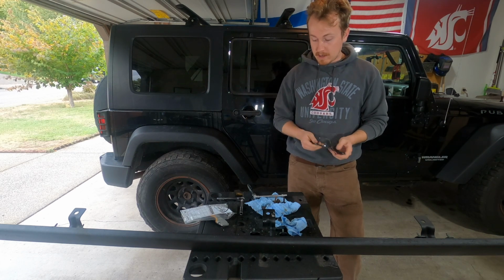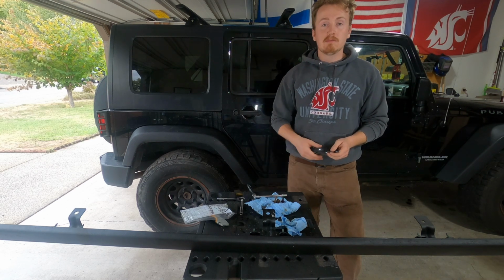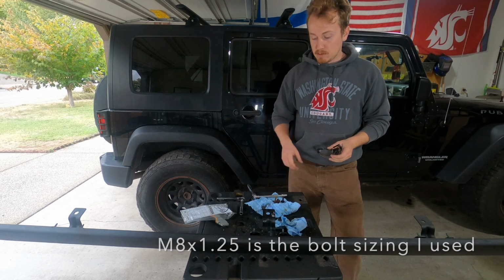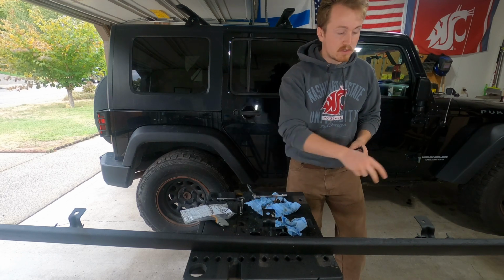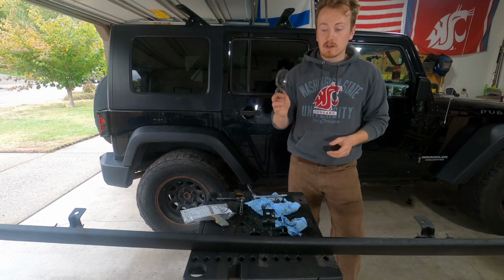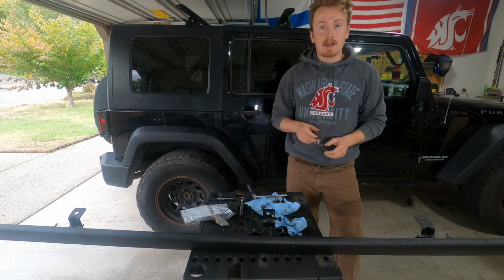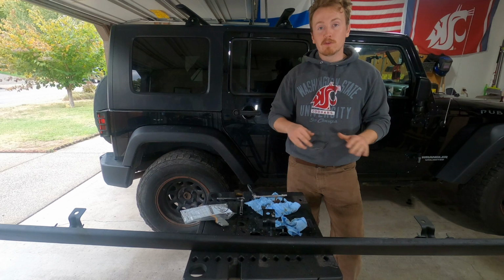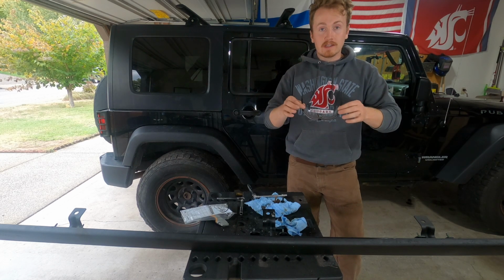But I went to the good old-fashioned Ace Hardware and picked up some replacement 13mm bolts that we're going to be putting back into the main attachment point, and then I just cleaned up all of the 10mm nuts that go back onto the 6 bolts or studs that are on each of the 2 rails. So once again, if you're doing this 2-person, probably the easiest, but we're going to get that car jack back out so that we can help ourselves lift this into place as easy as possible and hopefully not scratch up our brand new paint to get these reinstalled.